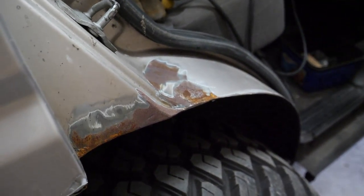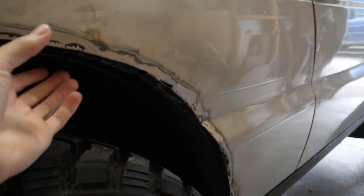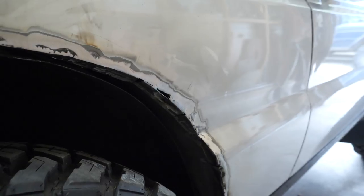I'll open up inside. As you can see, there's a lot of work went in there as well, but I'll show you exactly what went on when we do the chop today. And then on the door side of things, as you can see, I've got a few relief cuts, not the prettiest, but that'll all get sealed up. But essentially cut it and then pulled the inner skin up and have welded it together. Don't mind my wee whoopsie there, that was a rogue angle grinder. Anyway, that's what we're going to recreate, and I'm going to show you the steps on how I did it.